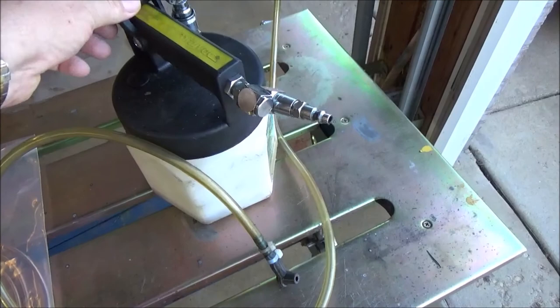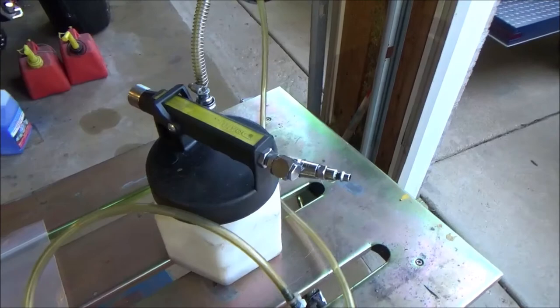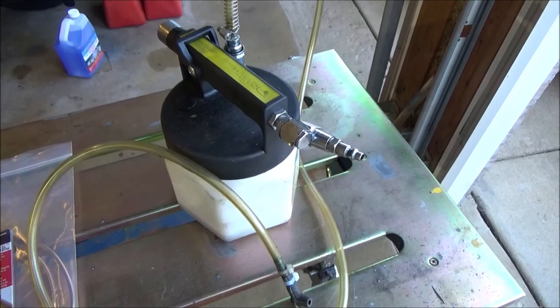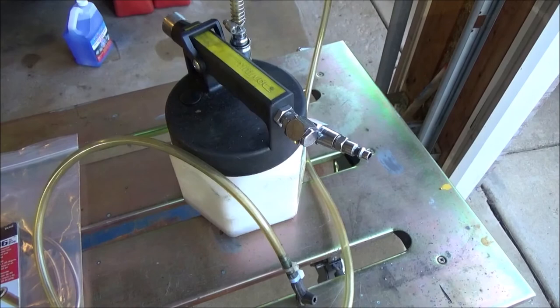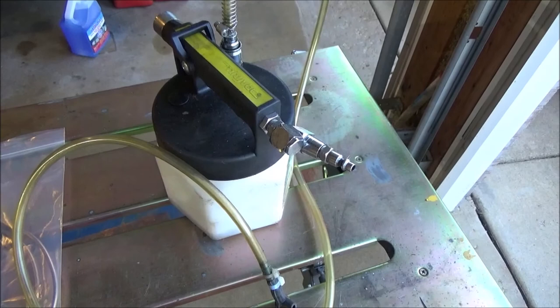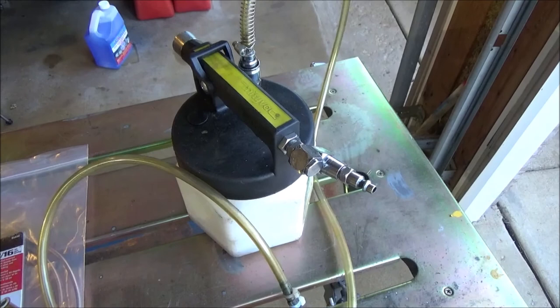It's just going to suck the fluid through. Now, if your master cylinder has plenty of headroom and you're doing this as a one-man person, you can invert a quart of brake fluid and sit it right on top of the master cylinder. They give you adapters for that, so you don't even have to worry about bleeding the master cylinder dry. It's constantly feeding things in, so it's a really nice kit. In this case, with the front of the boat trailer, we couldn't do that. My son just sat up there with a funnel and made sure that we stayed topped off.